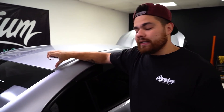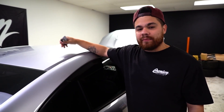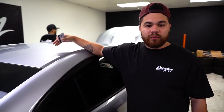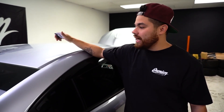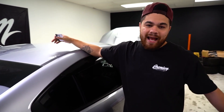I will mention that this is something you do to your car and you don't leave it on long term. You want to have this on for about a year to two years, and then you're going to remove it. As long as you do it within that time frame, you won't have any issues. The idea with removing it is to make sure the material doesn't cook to the roof cap — if you leave that on for extended periods of time, you will see the material begin to deteriorate. It's a good idea to remove it within a year to two years and simply replace it or leave it off. Your roof is preserved for the time it was wrapped. A lot of Japanese vehicles have really soft paint, and over time the sun will cook the roofs and they'll eventually have clear coat failures. So putting this roof wrap on will protect that, preserve the paint for extended periods of time — and it gives it a really cool look.